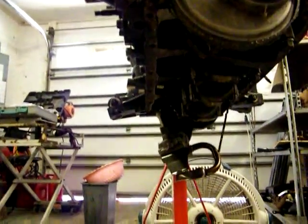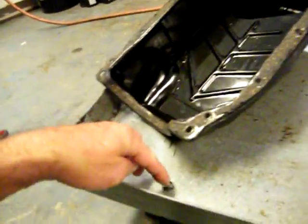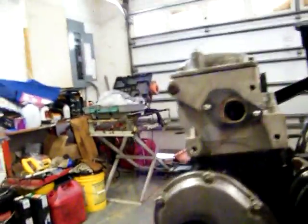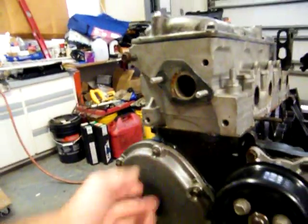We'll pin it over and look at it. Damn. I wasn't expecting to see that. But that could be why I don't have any oil pressure — that freeze plug. There's a plug right here, right behind this gear. There's a gear right here. There's a plug in there. It could have popped out and came right down through the front, right there, through the timing chain and into the oil pan. That's where I lost oil pressure. I guarantee you.